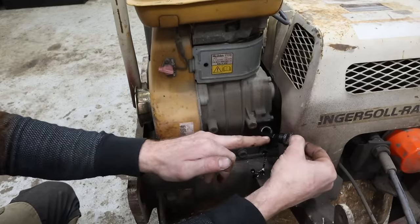So it should, it's going this way when pulling it out. So this should either wind it up or it's broken in there. And it's feeling like it's broken because it's not winding. Sometimes when the cord breaks, you get the ability to wind this up, feed the cord in, put it back through, tie a knot, and then boom, you're ready to go. It's not working that way. So let's take it apart. Let's see what we're working with in there.